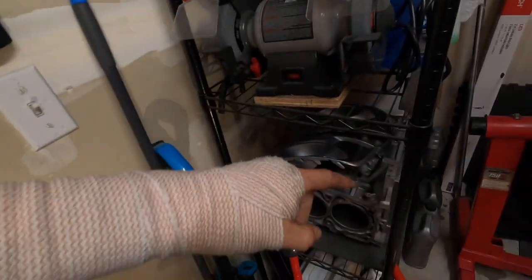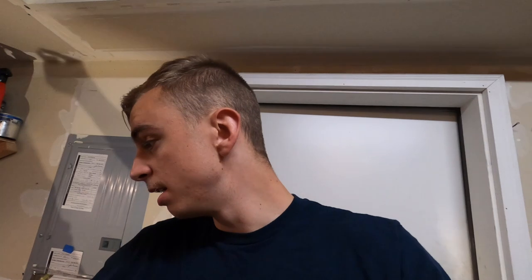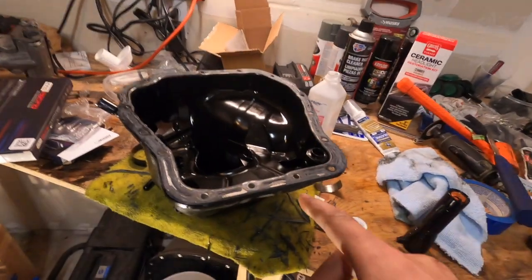If there's something in the oil pump, well, it'll be in there until we — like I said — this block's only going to hold us over until we get that other one back from the machine shop. I'm not going to be driving the car much — I just want to be able to start it up and drive it if I need to, test out the coilovers, stuff like that. I just don't want it to be obviously knocking. I did torque down the rod bolts to 38.4 foot pounds — that's OEM spec. For the tray and the oil pickup I did 8 foot pounds, and for the oil pan itself it's something like 4 foot pounds — it's very light. The sealant is what really holds it on there.